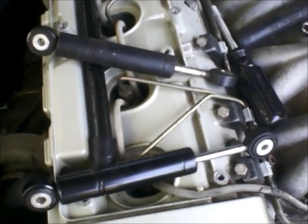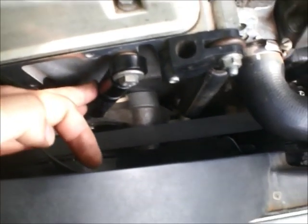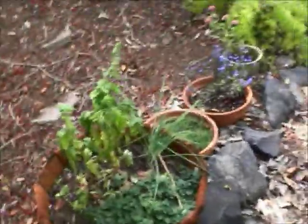This is the new part installed. What's really important is to recheck the routing of the belt, because we took it off. Before you start the vehicle, make absolutely sure the belt is sitting perfectly everywhere — really, really important. I also want to share the end result with you: it was really, really noisy before. Let's start it up and hear the difference together.